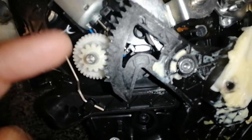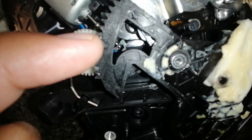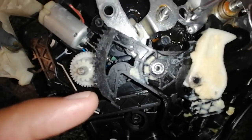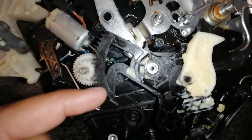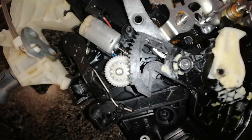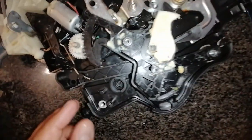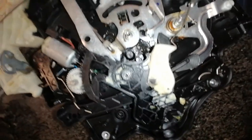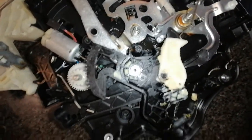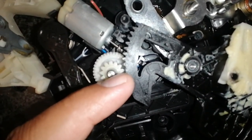This white gear is connected to the motor, which spins very powerfully, and it's got a common problem of breaking the plastic teeth. These two items are made from a type of hard plastic or nylon material which is actually not strong enough to withstand the powerful motor spinning this gear to open up the latch on the lock mechanism.